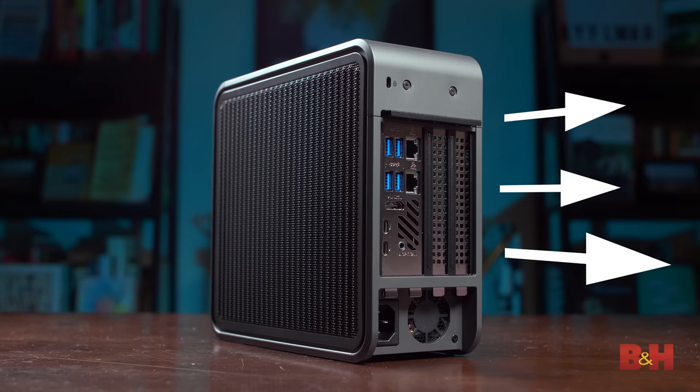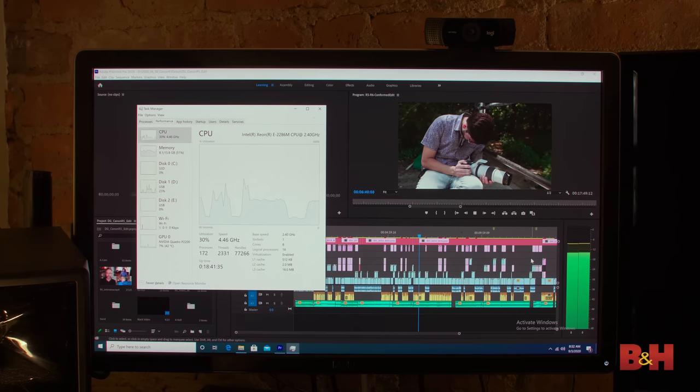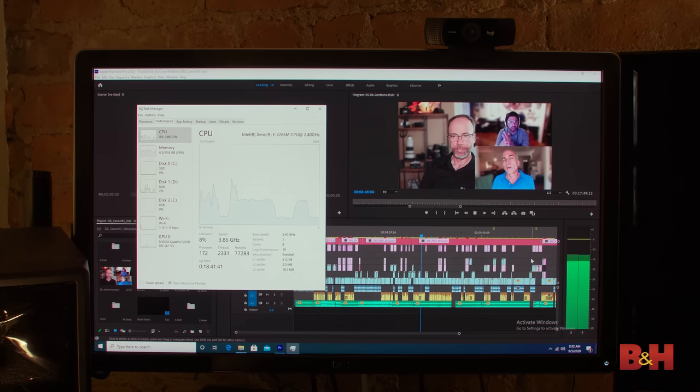If you look closely, you'll see that the compute module uses what's commonly called a blower-style fan setup. The air is pushed out the backside of the computer as opposed to the space around the card and in the case. Such setups are pretty common in desktops with tightly packed internals. After we're done, I'm going to look at thermals under load, so don't worry just yet. So let's close up the NUC and install an operating system. I've skipped ahead past the installation process because, after all, the beauty of a NUC is that it works almost exactly the same as a desktop computer.